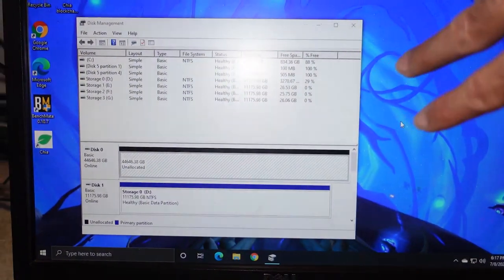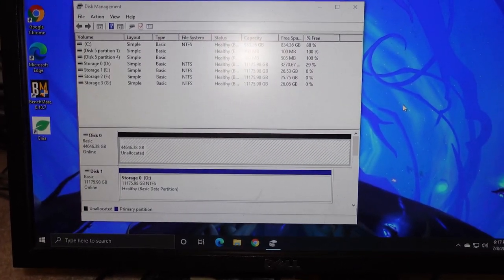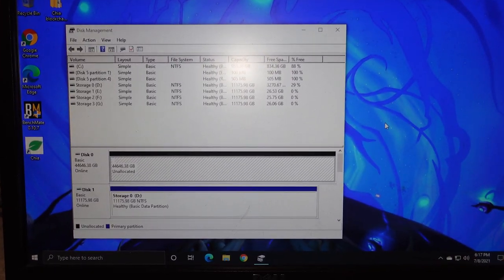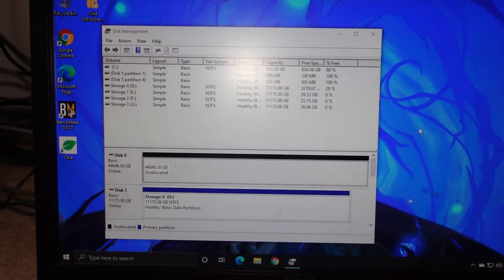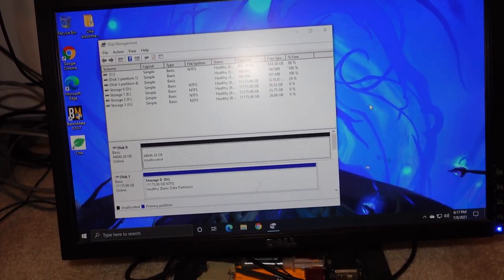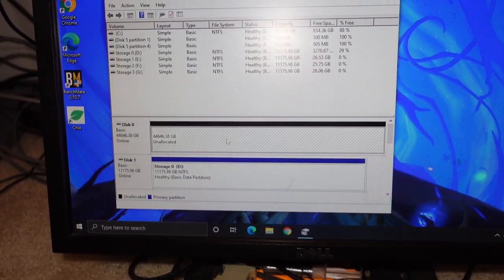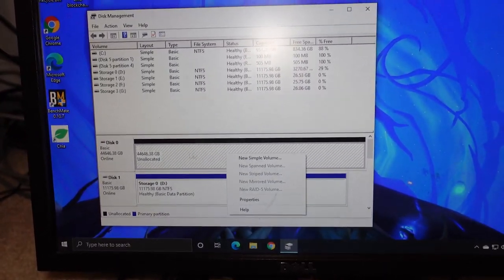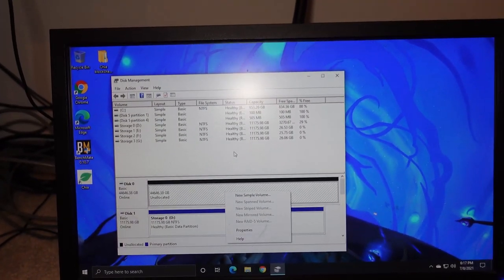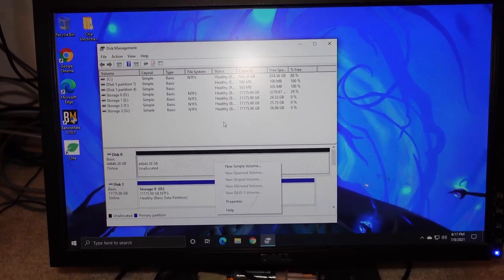The best way to set it up is I'm gonna put 4 16 terabytes in one volume, or one disk group, and then I'm gonna put the 12s in one disk group. But I need to find that last 16. But once you configure it, which is actually pretty easy, you just come into Windows and Disk Management, and you should get that pop-up window to initialize disk. You know, choose the usual GPT partition, it gets all set up. And then kind of go from there.